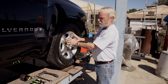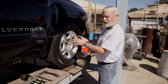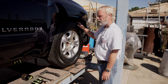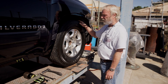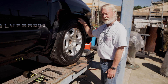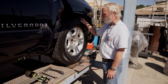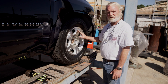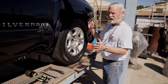We've eyeballed our wheel — we've got the camber as straight as we can, the toe as straight as we can, and we've secured the steering wheel. Now we want to talk about caster for a second. Caster doesn't have to be as accurate as camber. Camber's going to be all about tire wear — if you don't want to spend time at the tire store writing big checks, you want camber as close to zero as possible. If you go 0.5 negative, your tires will give you about 7,000 or 8,000 miles and then you're done. Caster can be within one degree on each side — if one side is 4 and one side is 5, you're done, lock it up, you're good.